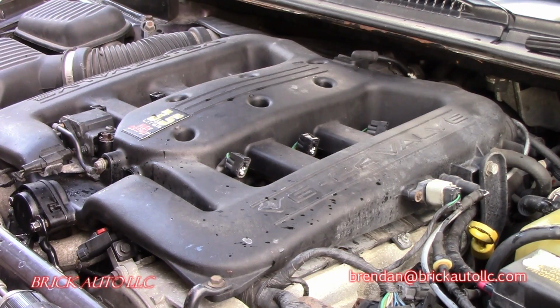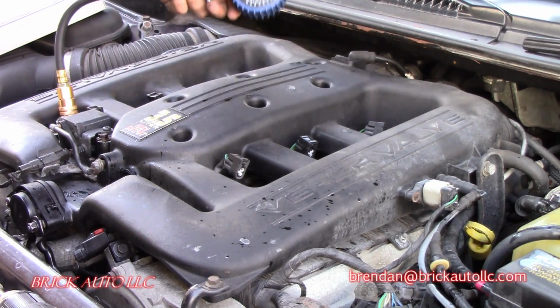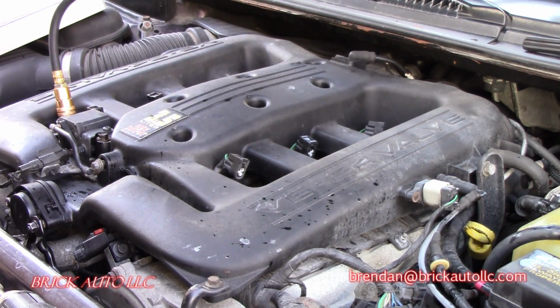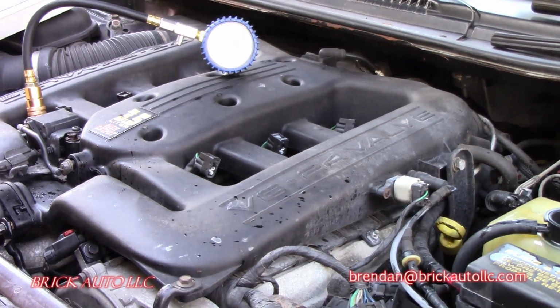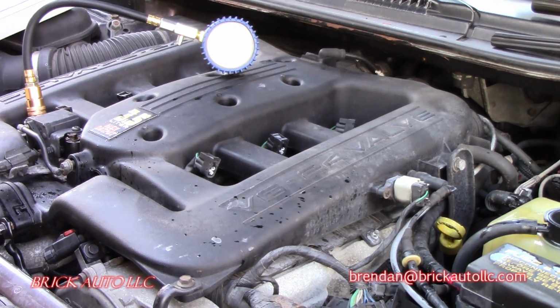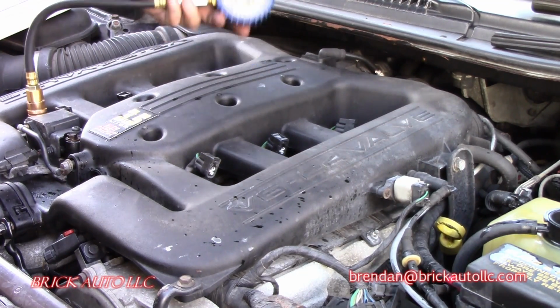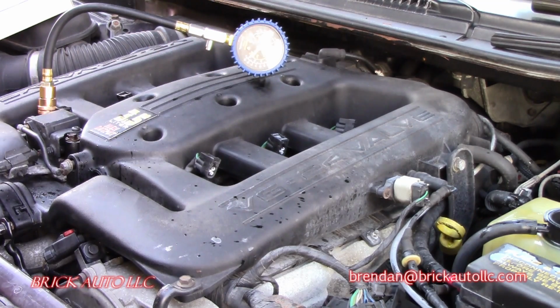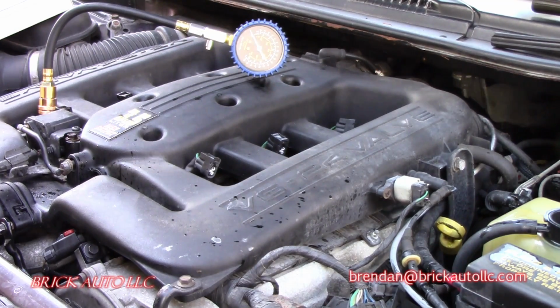Anyhow, let's do the compression test. So I tried one crank on this cylinder, somewhere between 80 and 90 psi on that one. Interesting. Maybe we should have started with this. About 85 again. Just going to write that down, keep track of each one of these. I'm going to do each one three times, just make sure we're getting consistent results.